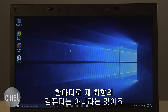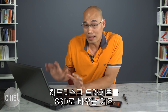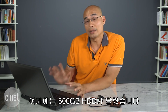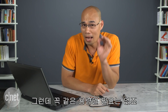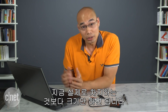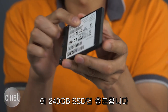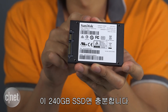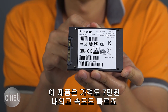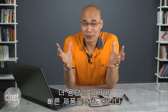There's a simple way to improve this machine's performance by a huge deal: replace its hard drive with a solid state drive, or SSD. The machine has a 500 gigabyte hard drive, but I don't need an SSD of the same capacity — just one with more space than the data currently on the drive, which is about 40 gigabytes. So this 240 gigabyte SSD will be more than enough, and it's a budget drive costing around $60.